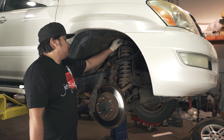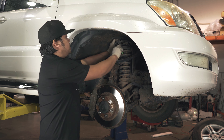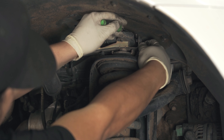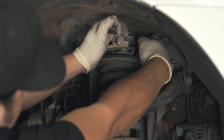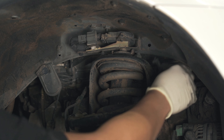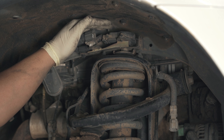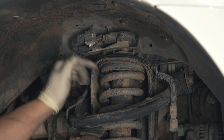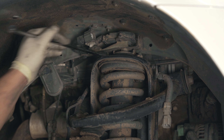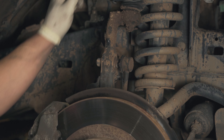Moving on to the front. We're going to access the electronics for the suspension dampening, remove all the suspension dampening, and then remove the shock. First off, we need to disconnect the connector right here. Use a 90-degree pick to pick out the back of the harness and push the release on the backside. With the harness removed, we're going to have to take off the motor for the shock dampening. But first, we're going to cheat it a little bit — we're going to lower the suspension down by loosening the top three 14mm nuts. Next, we're going to disconnect the sway bar end links so the tension is off the suspension on this corner.